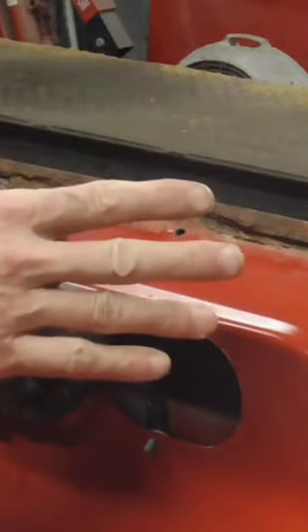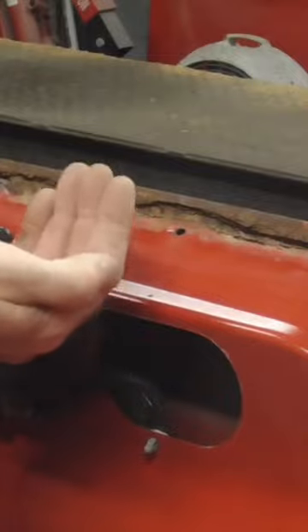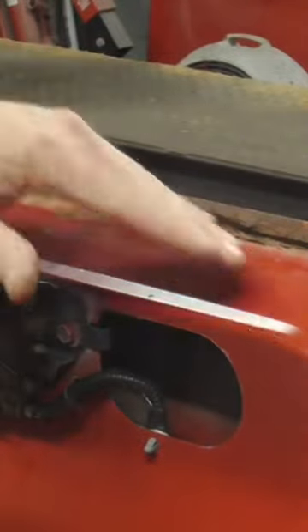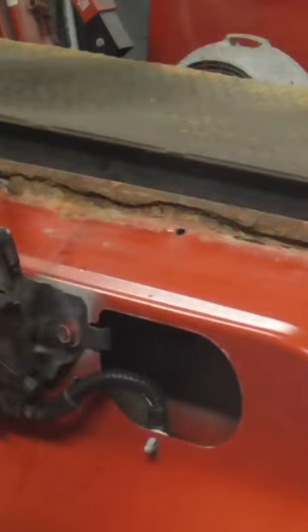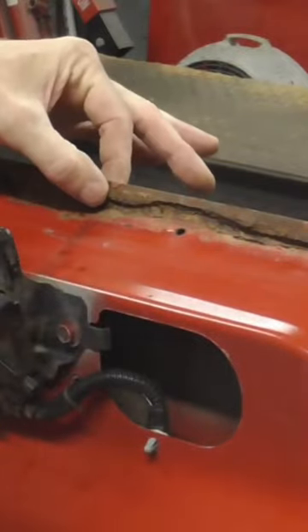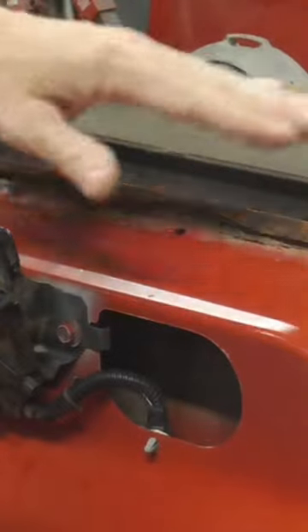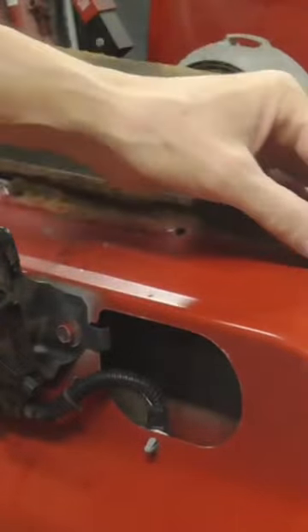This didn't happen because the paint just chipped by itself — it rusted from the inside. There's paint on the outsides, but there's no paint where those pieces of metal are folded together. It's just pure raw, clean metal in there, waiting for that salt water to rust it.